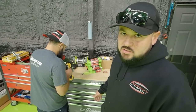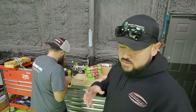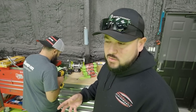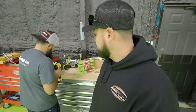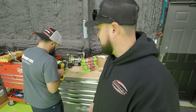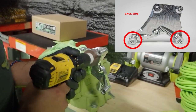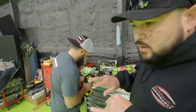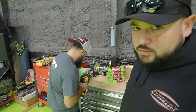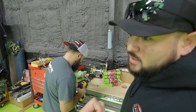I went and bought this $300 bracket — I'm doing this 6.6 iron block and the AC compressor doesn't bolt onto that block, so I had to buy the bracket from LME for about $300. It doesn't fit — it just sits flat and the OD of this is not the same as the block.